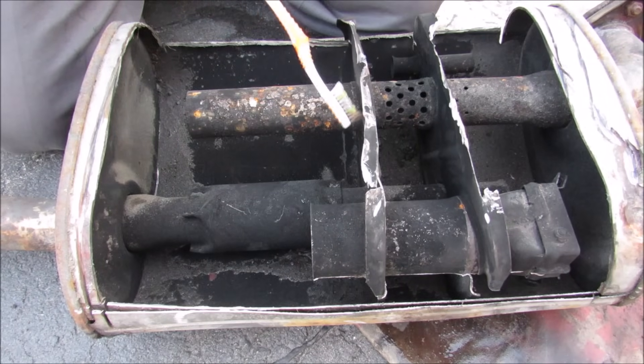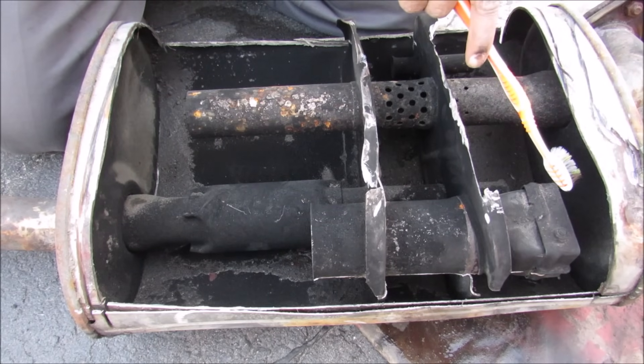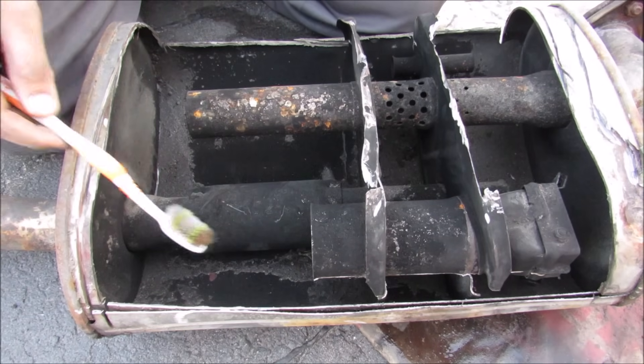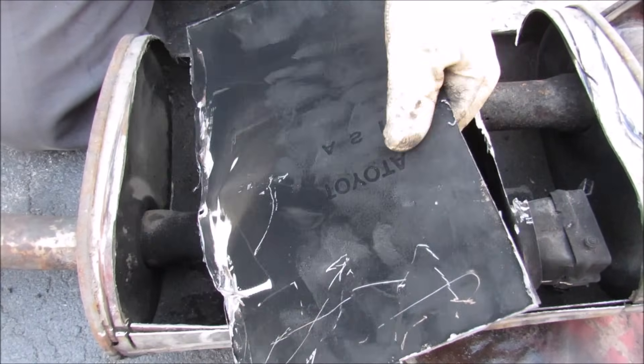As you can see there's quite a lot of engineering that goes into designing a muffler — from the distance between these baffles to this active trap door that varies the frequency according to engine RPM, as well as the double material used on the outside shell to dampen sound. Most OEM mufflers are made of a really high grade dual-layer stainless steel, which is why they last so long and don't rust out.